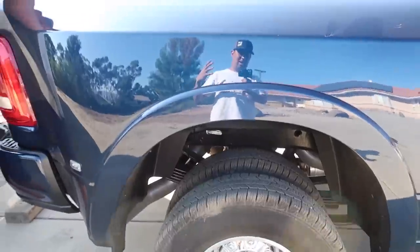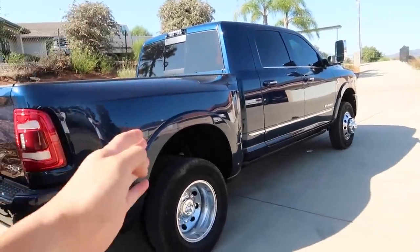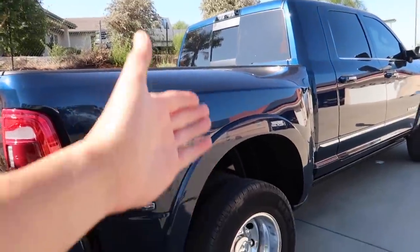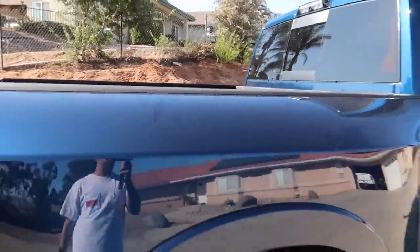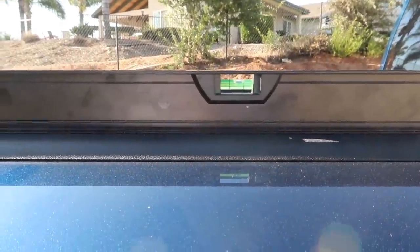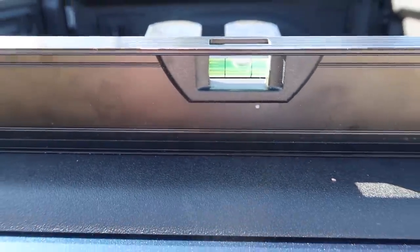So we want to do a squat test or a sag test and I'm curious to see the difference. We're going to hook the big ding ding up and set it down. We'll take a measurement with nothing on it - you guys can see there is no weight currently on there. We're going to see how much this thing drops, and I'm also going to put a level on here to see how much that bubble moves - if it levels out or if the thing is still stink-bugging a little bit.